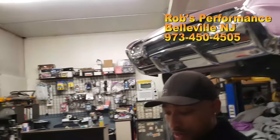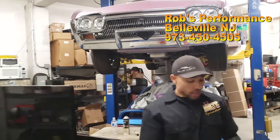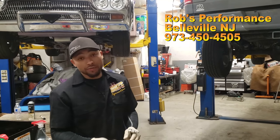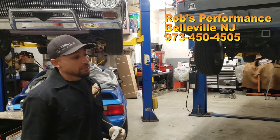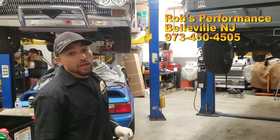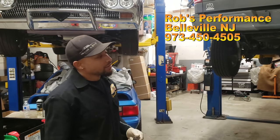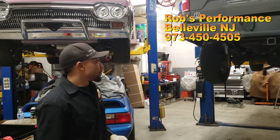So I usually do on posi units, I'll drive them down the road normal. You know, do a little S, like swerving a little bit down the road. Obviously don't aim for anybody. And then once I do that, I usually go to the highway and make sure nobody's around and do a nice little burnout in the hole shot. And see if she stays together. 9 out of 10, you ain't got no problems. But that's what we usually do, make sure the posi is working. And that's pretty much it.